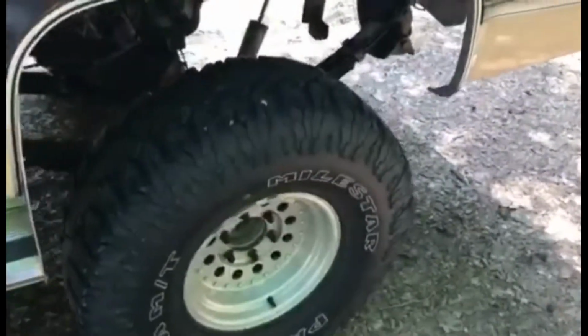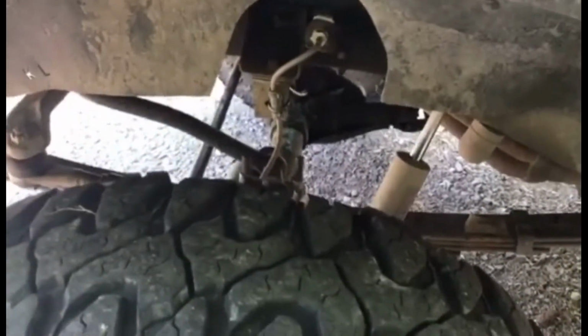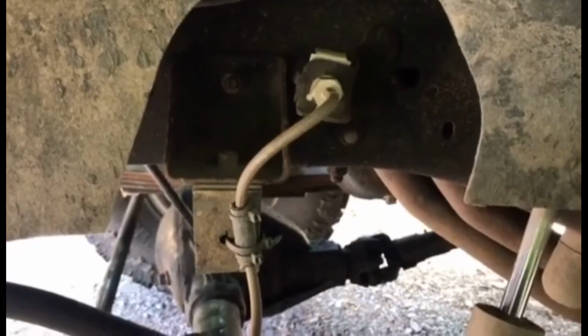I do have a rear 1.5-inch spacer to level my track width, because I'm one of the people, if it's off just a little bit, it's going to bother me. I haven't had a problem with the spacer. I did add the 4 to 6-inch brake lines because other ones weren't long enough. I will say you need to make some sort of little bracket, because these are long enough they'll tap your tire. I found that out because I started rubbing the inside of one of these and it could easily put a hole in it. But yeah, I think it's a good combo.